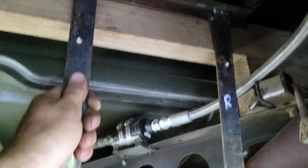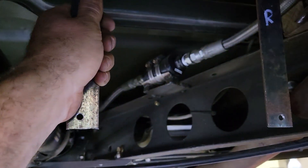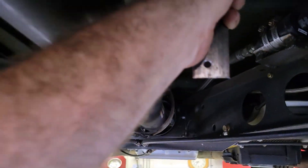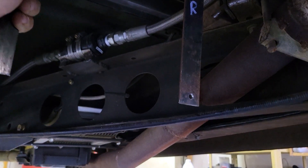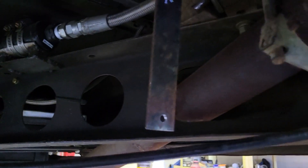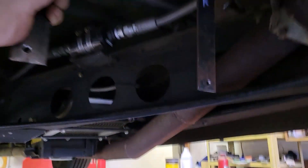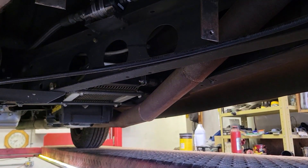I'll weld that to the bottom of the box. The cooler will hang vertically. I've got a little close to the drive shaft there, but I can't see that being an issue. I've got my drive shaft loop there, and it's not like those go side to side anyway. So plenty of room there, and then I'll just tie in this bottom hole here over to the frame there. That should stabilize it — I don't think it's going to go anywhere. I'll just get to welding that in and work on that bottom brace.